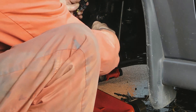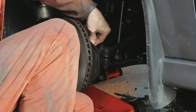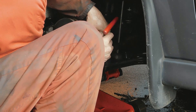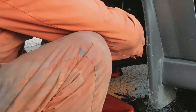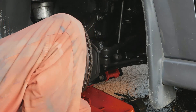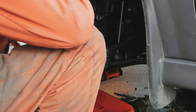Nice and clean. Push it down with your fingers — here's why: it's got a single bolting tab. If you haven't pushed it all the way in and you bolt it in hard, you could crack the thing. It's got a little brass or bronze insert there. If it's kicked over and you just force it in with the bolt, you could end up cracking the plastic housing. If all you wanted to do was clean it off, well, that'd be a bummer.